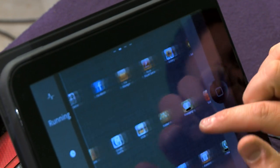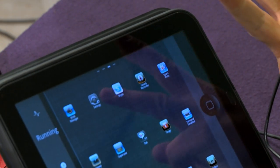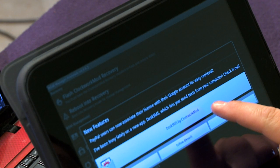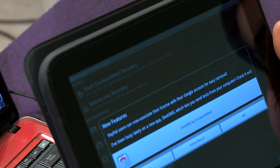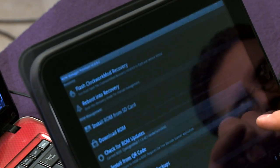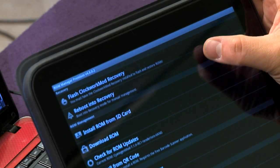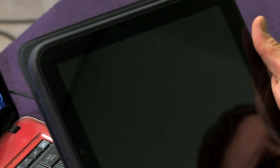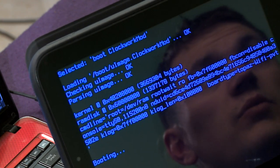We're going to launch into Android, then go to Power Down, and it'll ask if you want to reboot into Recovery. There are three ways to do it. On the first boot, you can cycle through your OS options and go into ClockworkMod. Once you hit the Power button, you have an option to go into Recovery, or you can go right into ROM Manager and choose to reboot into ClockworkMod Recovery. So you don't have to hit any buttons — you just go into it from the menu.